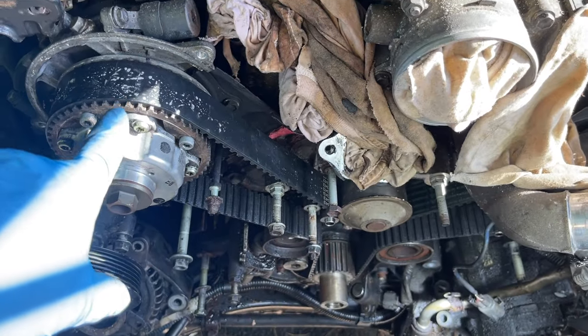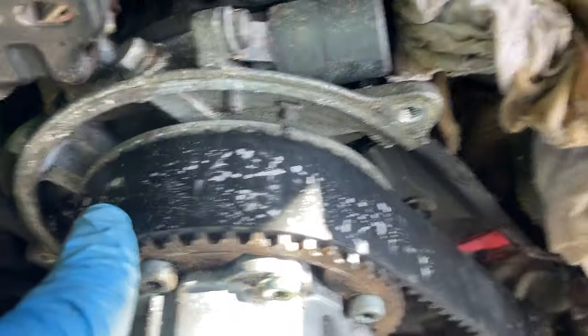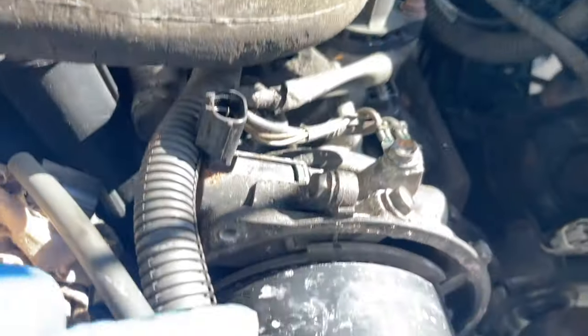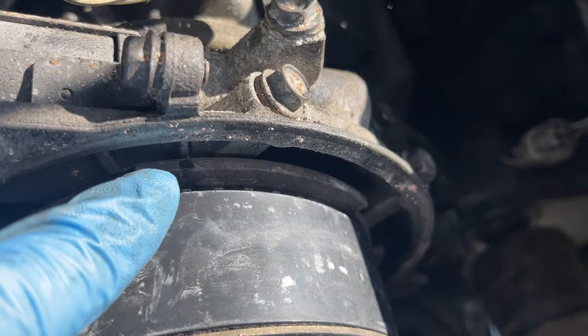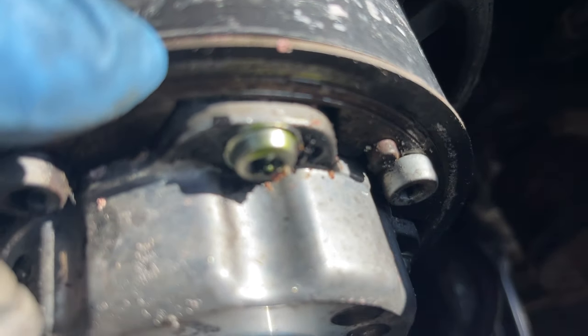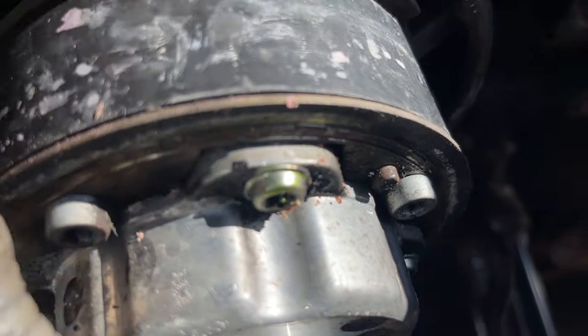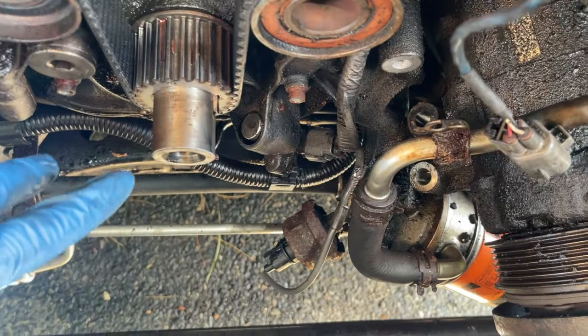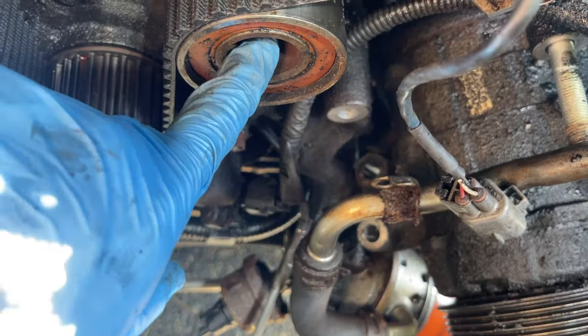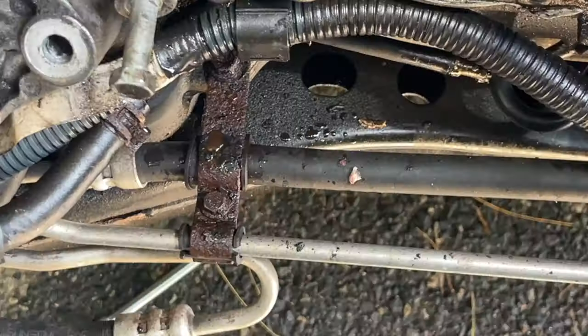All right, since we have the right camshaft calibrated to the timing mark there, we have the left or driver's side cam to the T there, with the green mark there, and the little hash mark that we talked about earlier, right about there. And we noticed I pulled out the harmonic pulley, and another key indicator to make sure you're in the right position is this little nubby thing should be aligned with this bolt here. That tells you everything is in perfect timing. So now we can start pulling out the timing belt tensioner, which is here.